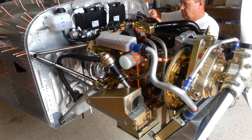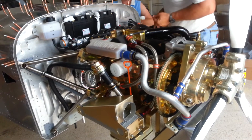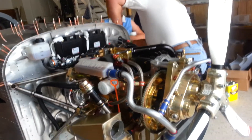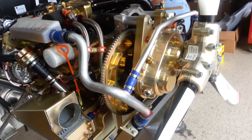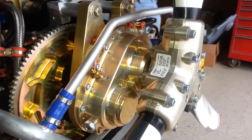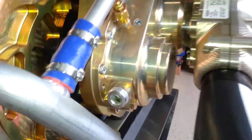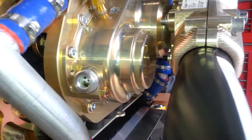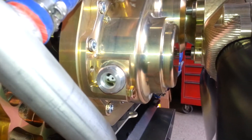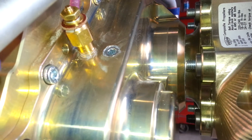That covers the fuel, oil, and coolant. The NPG coolant is available from us and also on Evans Coolant's website. Moving to another fluid: you need gearbox oil. You're going to use 100 milliliters — we say milliliters because it says that right on the bottle, and we also have the ounce equivalent on our website. This plug up here is your fill plug for the gearbox oil.